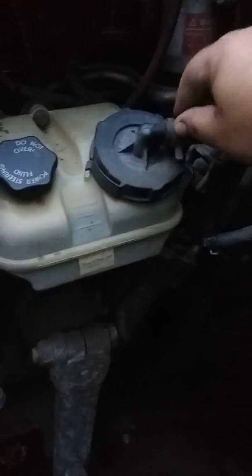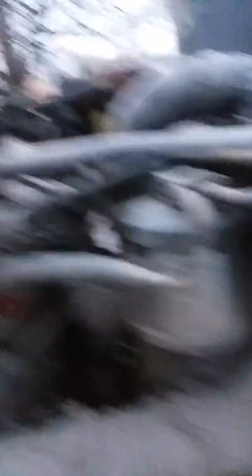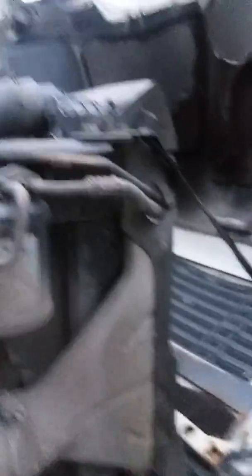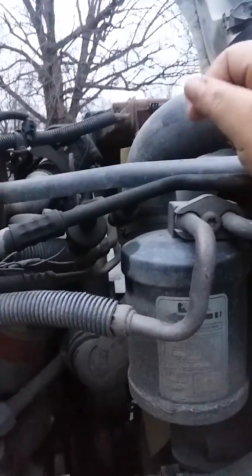So what I did last night — I wanted to make a video of that last night, but it was too dark when I got off, so I figured I'd just show you all the aftermath of what I did. I went back and tightened up every little hose connection because I noticed I had a leak coming down on the side right here. I followed that entry point and it led me right here to this hose, which is connected to the coolant reservoir. I got up there and tightened the clamps. Now in most cases, at the end of the hoses you'll have a clamp — some of them with a screw. You get a flathead and tighten that up.